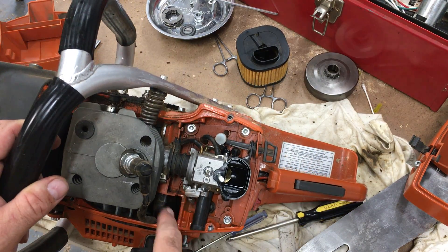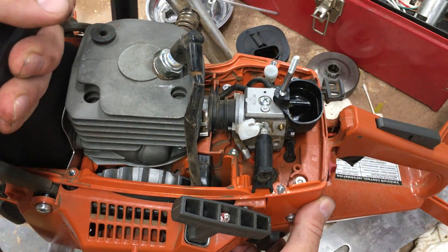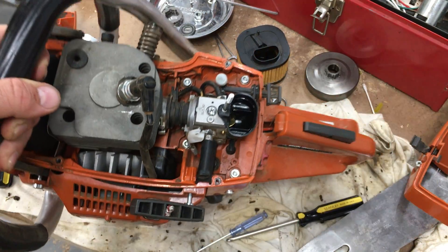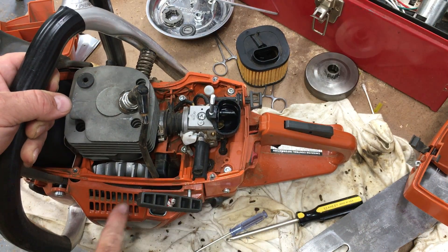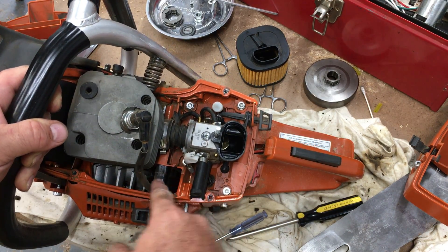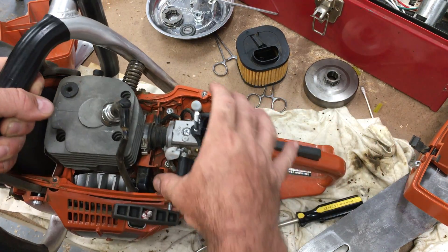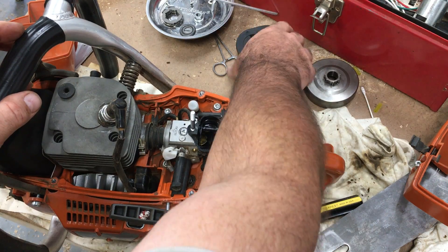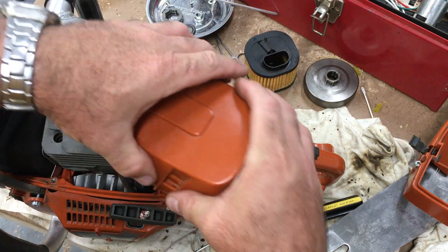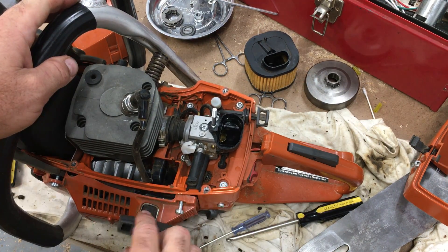That's something I couldn't get a good look at when I was researching — the setup of where the carburetor is. The flywheel is actually sucking air in through these grates, blowing it up through a plastic channel — a little vent system that blows air into a box, which then feeds through the air filter. That's how this saw breathes. It does not draw air from around the cover; all the air is drawn from the clean side of the saw.